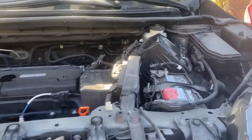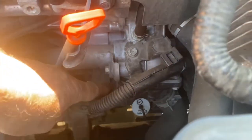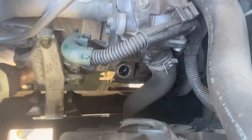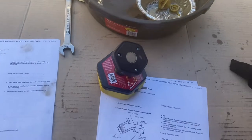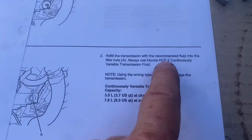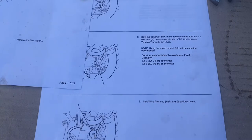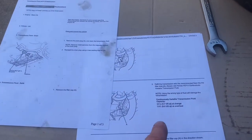Open the engine. Right here there's the battery, there's your dipstick to check your oil, and right down there is where you fill this thing — that's not where you check it, that's where you fill it. Let's remove that — it's just a rubber plug. Now it's way down in there. I'm going to see if I can get in there with just a funnel. I've got one-quart containers of this fluid. Make sure you get the correct fluid: Honda HC-F2 Continuously Variable Transmission Fluid. Get the Honda stuff or whatever compatible.